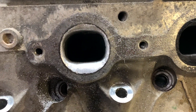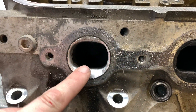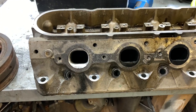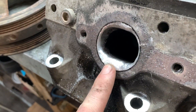Here we go with one port done - it looks a lot better, nice and flowing curve on it. I'm not going for a massive CNC port or anything. I just really want to clean up the hard edge, because you can see that the stock port is completely flat, makes a 90-degree turn going into the port. And right here, we come out and it's got a nice flowing curve so there won't be any drag or swirling at the edge. Almost like the roof of a pickup going into the pan - you always get a low pressure area there - we don't want that, we want a nice flowing curve. I'm going to go ahead and finish up all the ports off camera because I've got a lot of hours left. I just wanted to show one intake port, one exhaust port, to get the idea and not bore everybody with doing this like 16 times.